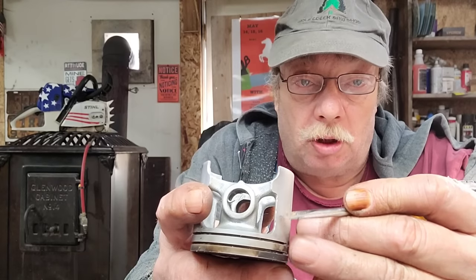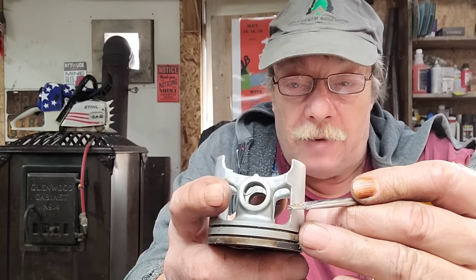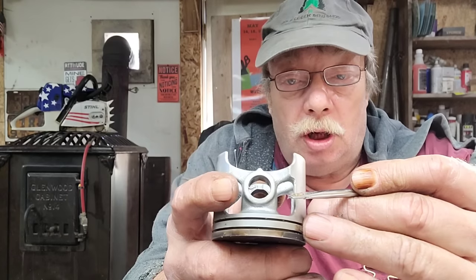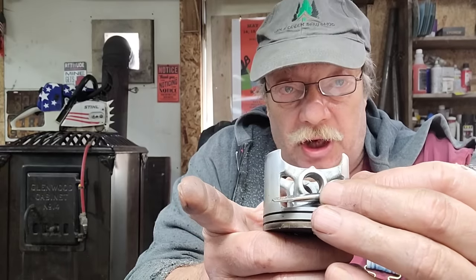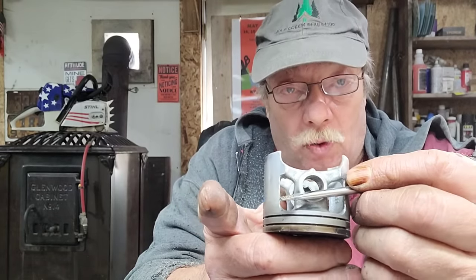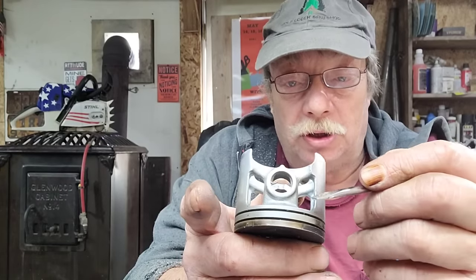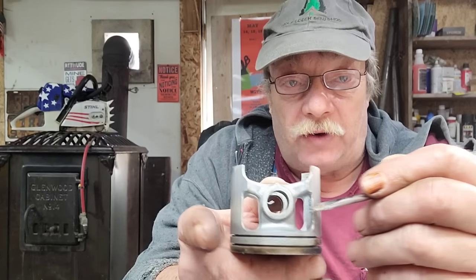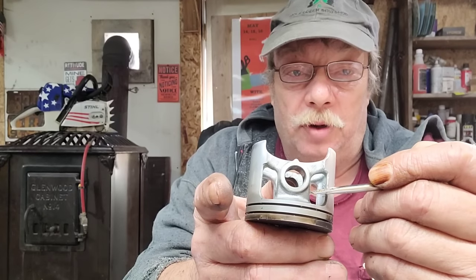This window — it'll do me no good to widen it a lot. I've got to see what my transfer is going to be. I'm actually going to tailor this particular piston to be wider on the primary side than the secondary side, because each side feeds one or the other. So I'm going to carry you through this — these are factory dimensions.